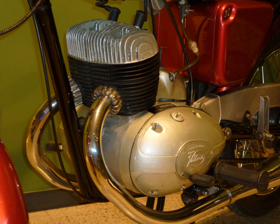From the 1930s, following the work of Val Page, most British four-stroke parallel twin motorcycles used a crank angle of 360 degrees, which allowed the use of a single carburettor. 180-degree and 270-degree twins need twin carburettors because of uneven pulsing. However, in the 1960s, Japanese manufacturers favoured the 180-degree whose smoothness allowed higher RPM and thus more power. For example, the 1966 Honda 450 cc DOHC 180-degree 'Black Bomber' could challenge contemporary British 650 cc 360-degree parallel twins. Many small motorcycles of less than 250 cc use a 360-degree crankshaft as the vibration issue was less significant, including Honda's CB92, CB160, and CM185.